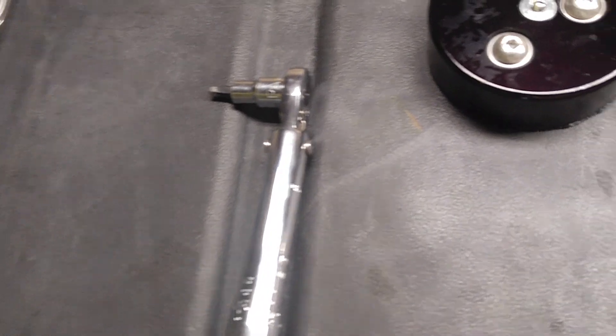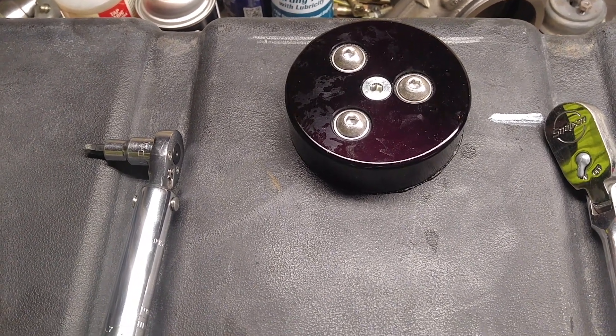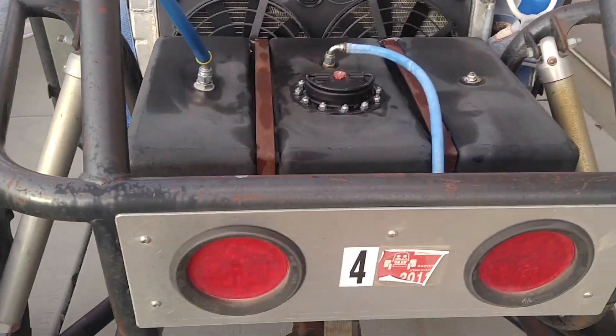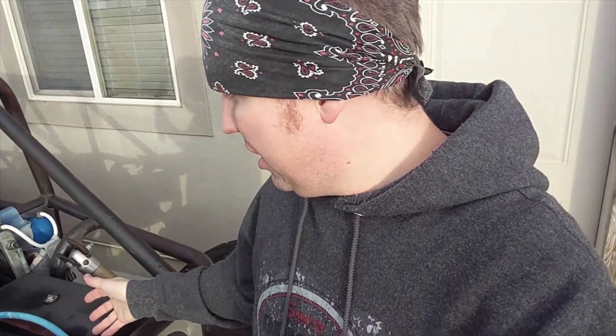Got her put on — torqued down to ten foot-pounds, and it seemed pretty snug. We're gonna put it back in the Jeep, let it dry, and get it all hooked up. Fuel tank all installed with the sump right down there, and it's looking pretty slick. We actually had the fuel tank installed for a few weeks — put the sump on the tank, let it dry for probably two or three days, and then installed it in the Jeep. We filled it up with fuel and it's probably been three or four weeks. We're not seeing any leaks, and I think this is gonna work out pretty slick. If this video helped you out installing this sump or showed you some information, give it a thumbs up, subscribe if you want to see more content like this, and go build something cool.